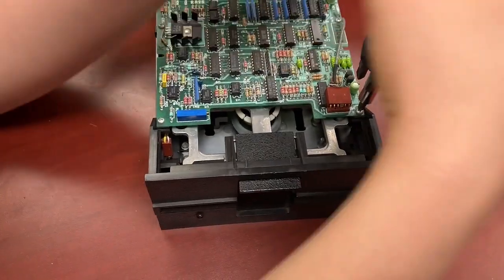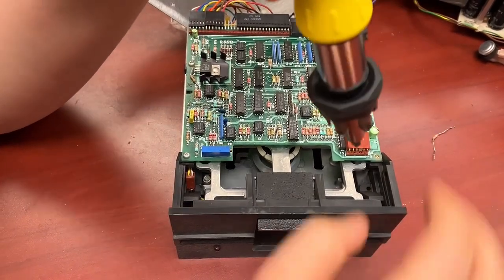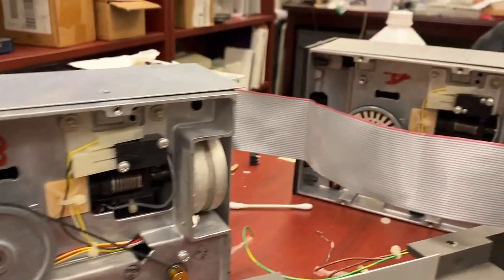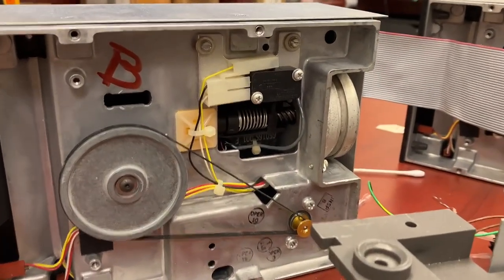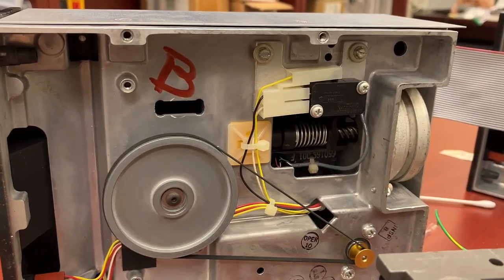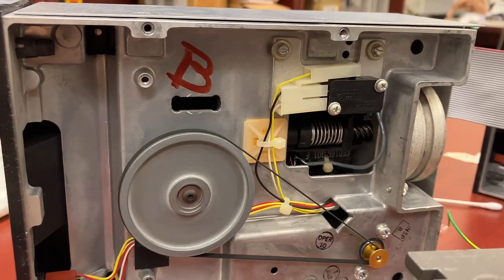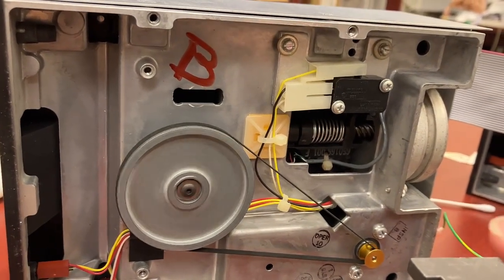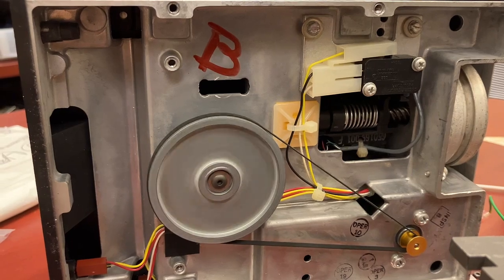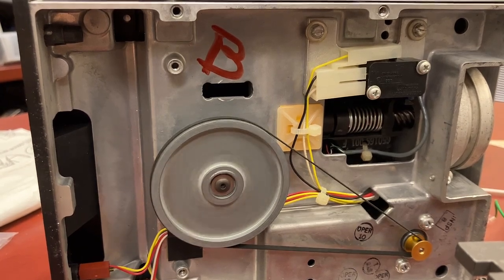So we're going to try to clean the heads and really get in there. Instead of using one of those little floppy-disk-size cleaners, we're actually going to get in there with a Q-tip. One of the discs gave us this before giving us an error. We're trying to get the Osborne to work — we swapped what's drive A and what's drive B. We're getting boot error or bad sector error. I want to watch this little head thing — is this guy doing what he's supposed to be doing? I don't see it moving. We're not sure if it's actually found the right track — I'm just having trouble reading the right track.